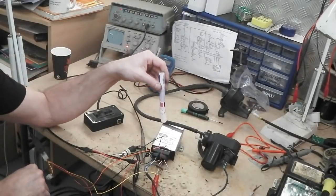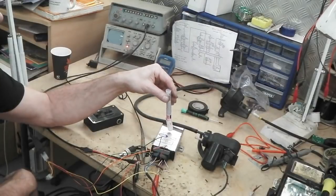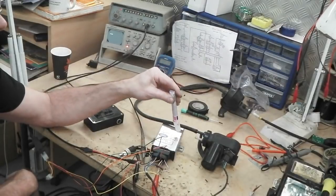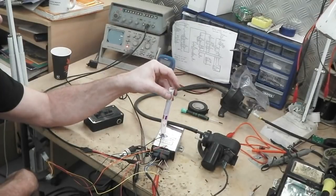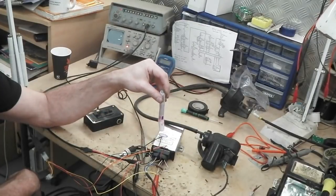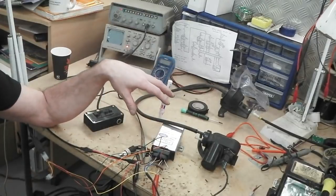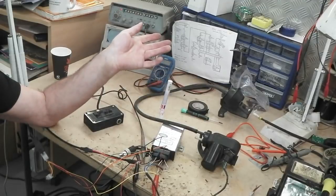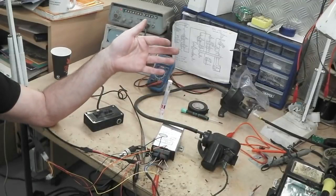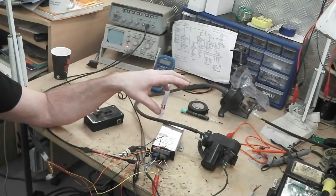And in the middle is the unit itself, a 5GA004-39718 Hella cruise control unit, in this case software matched for Land Rover. That's just the actual profile of the car. The software chip works almost the same across all different models, but some might be V6, some might be V8, some may respond in different ways. So the curve, the operating parameters of the chip would be different.